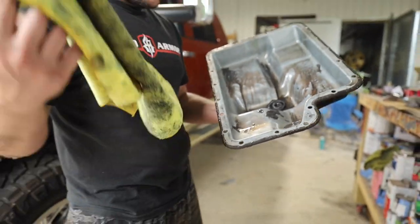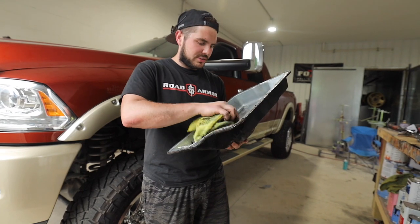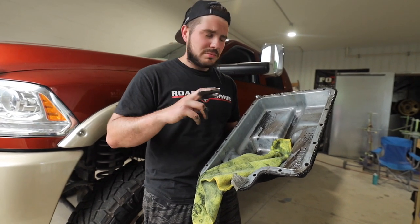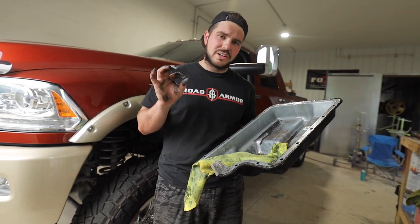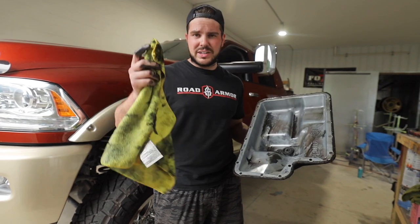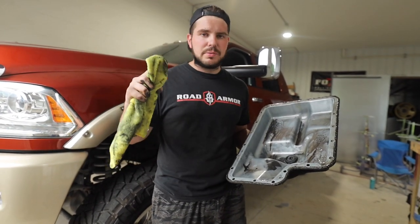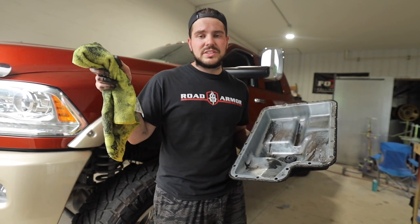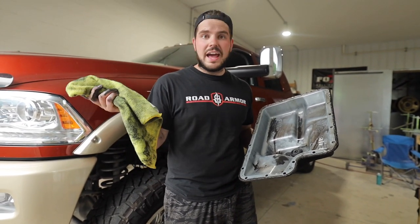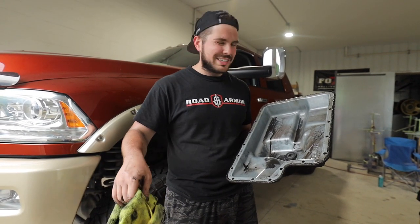We're gonna get this thing cleaned out. We've got a storm coming, so I'm gonna throw this pan back on — just to keep water from splashing up in there. I don't find that too crazy, so I think we may be okay. I'm not crossing my fingers saying the bolts are 100% gonna fix this — maybe a smoked converter, hopefully not a tranny. You guys in the comments are gonna have opinions — same symptoms have happened to others. Some people tightened those bolts and were good to go. Some tightened the bolts and the converter was smoked. Some tightened the bolts and then completely rebuilt the transmission. So there's probably a slew of issues — we may have one, we may have them all.